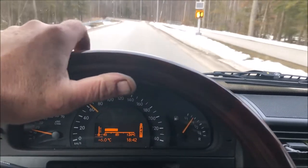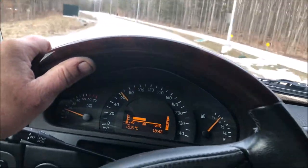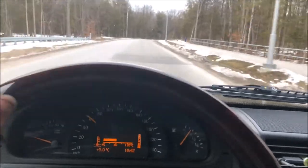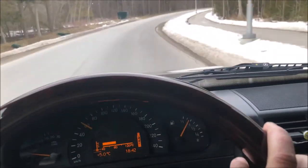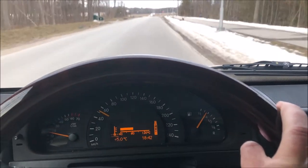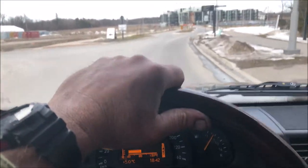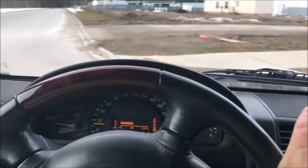So I'm gonna go down here, turn around at the corner and give it some throttle, and after high speed, high throttle, and then let off, we should be able to see whether or not it should trip. That's generally when an EGR will trip, if it's toast, in a lift throttle application. And it usually will not trip when the engine's cold. The engine has to be hot, because the EGR valve's job is mostly to cool down the intake air temperature.